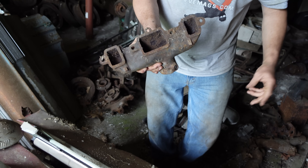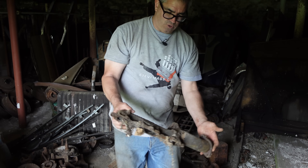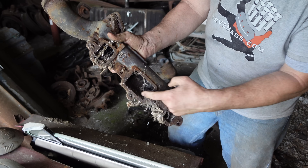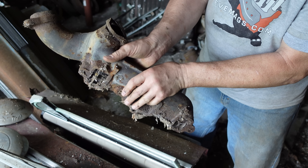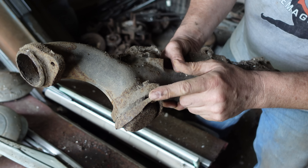It's from an Olds final generation V8. Something interesting here — this is definitely another Oldsmobile exhaust manifold. Again, we see the Siamese centers. The cylinder head had ports that were pretty good, but the manifold had a big wide open party spot in the middle. But this is kind of weird — look at this, it has two outlets, one here and one there.